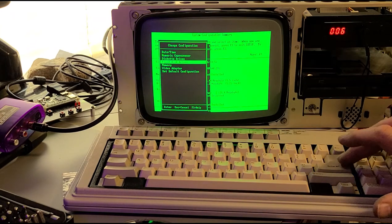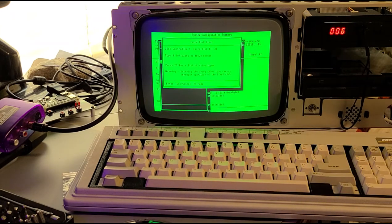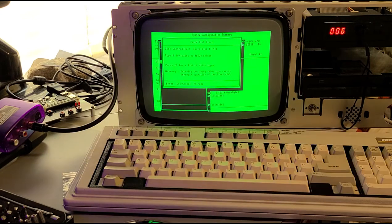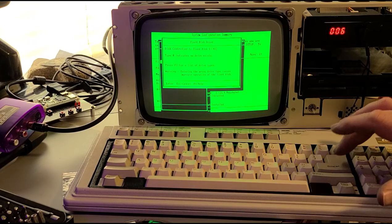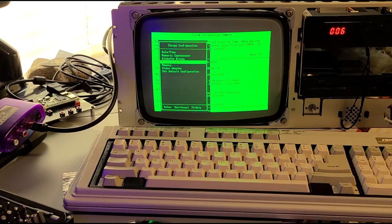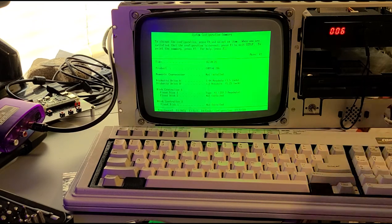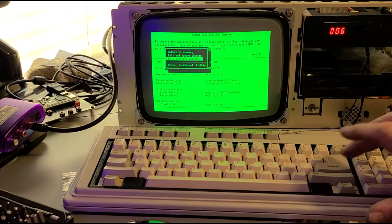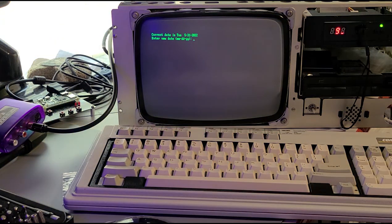So, after installing the IDE hard drive, the CF card rather, I ran setup. And according to a blog, which I will link below, it said to choose 41 as your disk type. So I added the disk here in the setup program. It was time to exit and save the changes.